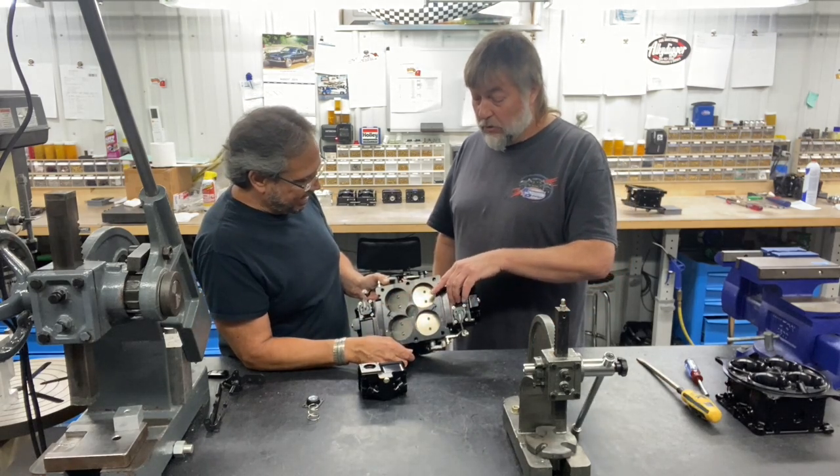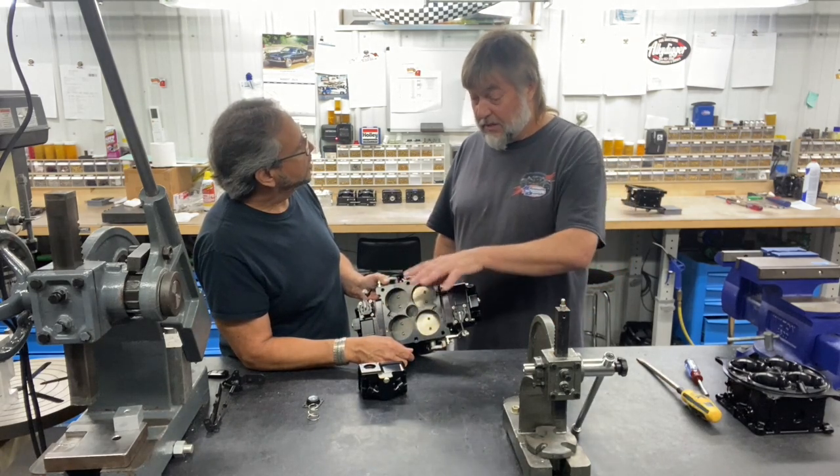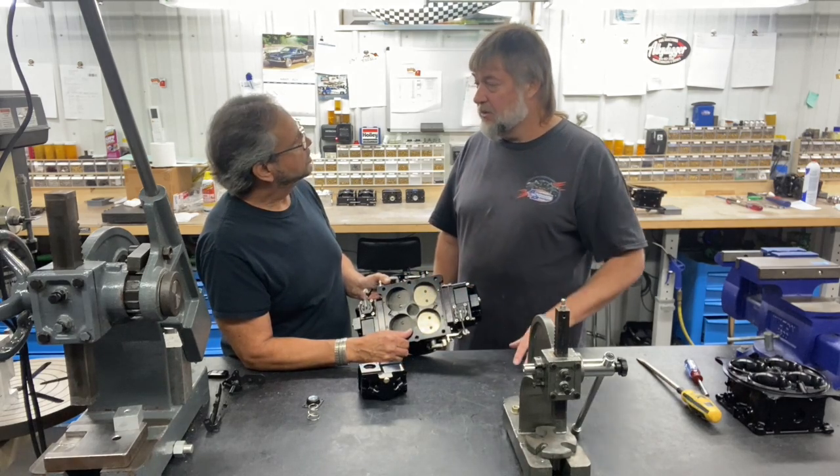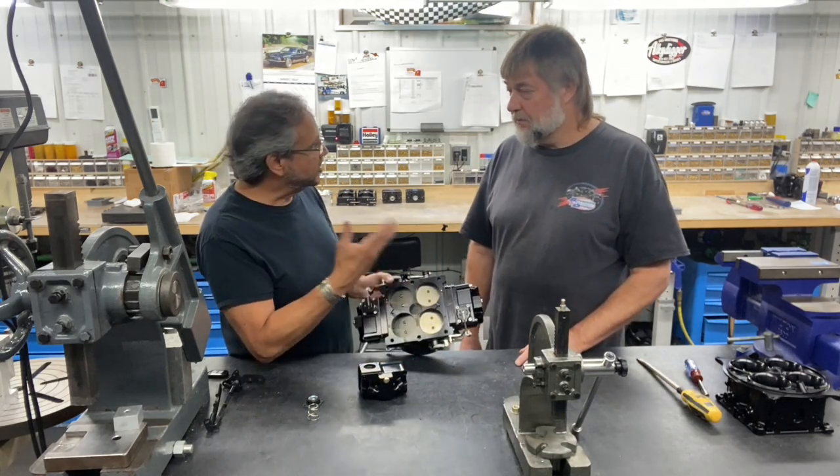Think about it — you've got flow coming through the venturi and now you're shooting fuel below the throttle plate. I would say atomization is going to happen the moment the air picks it up in the manifold — it becomes an atomized fuel mixture. You're talking maybe two inches of distance from here to the runner. On the dyno, the minute that fuel comes out it becomes a mist — you don't even see a stream.